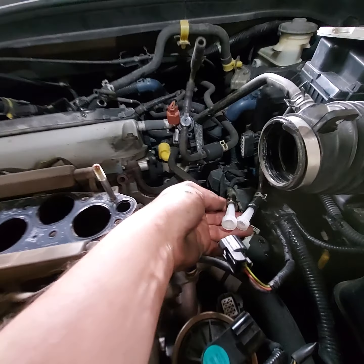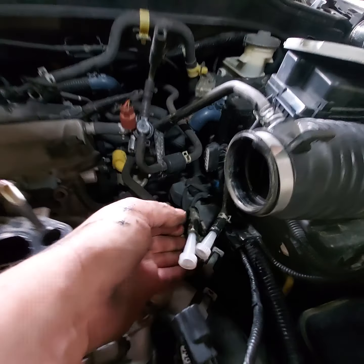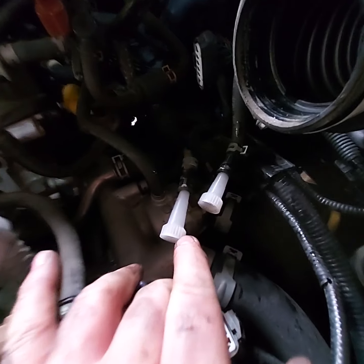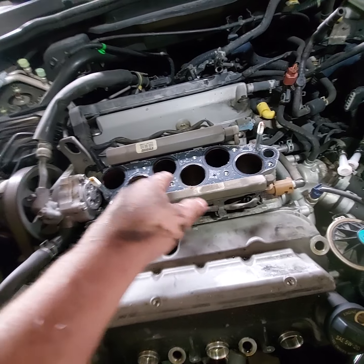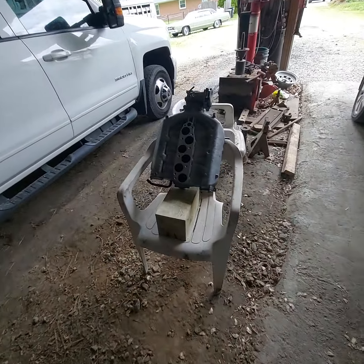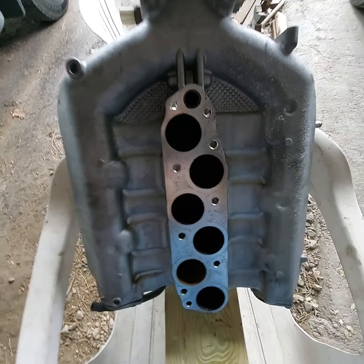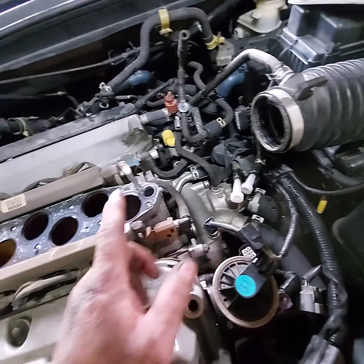On the bottom of the throttle body assembly there are two coolant lines you have to disconnect. All seven bolts are the same length, 12-millimeter head, and then you've got two 12-millimeter nuts, and take that upper intake manifold off. There's where your two coolant lines hook into your throttle body — that wasn't too difficult. I had to unhook these before I could get the manifold to come up very high. Turns out there's only one more bolt, not two — my eyes aren't working too good today.